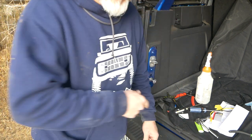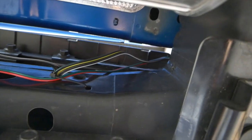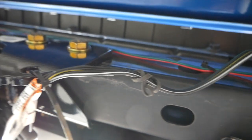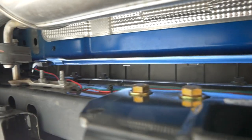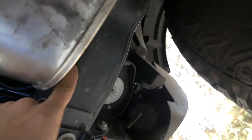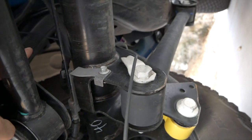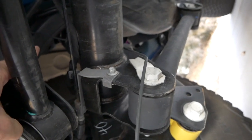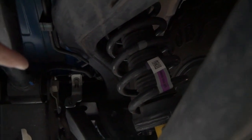That one is completed. Let me show you what I did to the wiring underneath. So underneath you've got the ground right there, the trailer wiring harness is coming in, and it is zip tied right over here to the receiver for now to get it out of the way. Then you see the other turn signal and brake light line going all the way over to the other side, and that's zip tied to the back side of the frame. Now I'm going to follow the frame back with the power wire until you get past the axle, and then there is a wiring harness loom back there that you can see. I'm going to pick it up there and follow that wiring loom all the way into the engine bay.